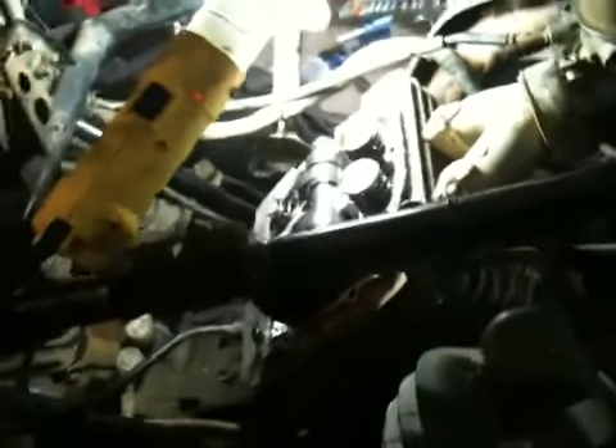This is a 600 Grizzly that I just got done rebuilding. When I put it back together and got it running, it seemed to be running pretty good, but seemed a little down on power and it kind of backfired every now and then.